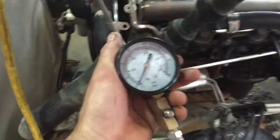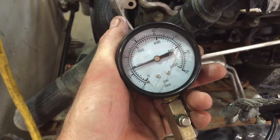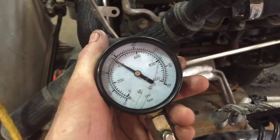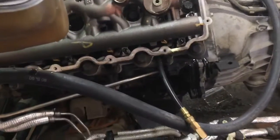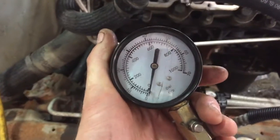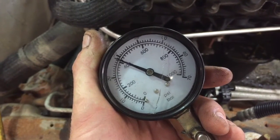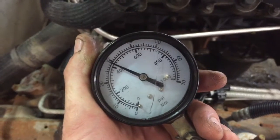That 360 number was a little low. This is still number 6. We're going to run it one more time. All right, we got 365, 405. I like that number. All right, guys, we got cylinder number 8. We call that 380, 420. So that one's pretty good. So we got a little lowness. Let's go over here to the board.